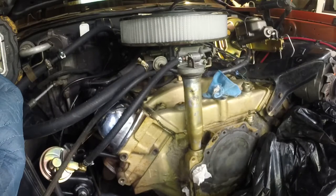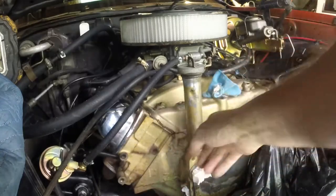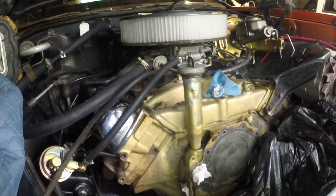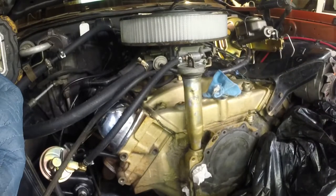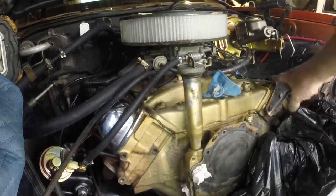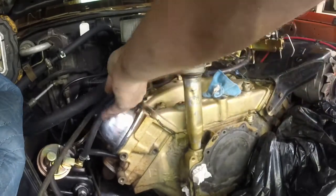So I'm going to have a multi-color engine here for a little bit, but it'll all look good when it's all said and done. I've got the whole front end torn apart, so might as well get the paint on there and freshen things up a little bit. Just using some lacquer thinner and a wire brush to get crud and stuff off, then I'm going to mask things off, use trash bags as larger masks for the suspension and other stuff, and use tape for specific stuff like the valve covers.